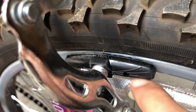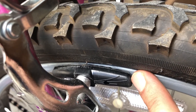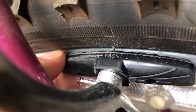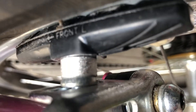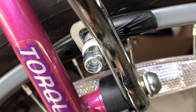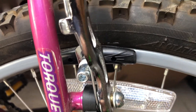I'm back with the other side, doing the brake pad. Make sure the brake pad is nicely aligned — you can see the gap adjustment between the brake pad and the wheel frame will be done later. This one clearly says 'front' with an arrow indicating direction. It's on the left side of the bike. Align it, making sure all these washers are aligned and the Allen screw at the back is aligned. Don't tighten it yet until you confirm it's nicely aligned with the wheel frame.